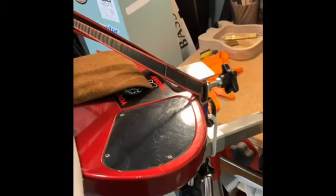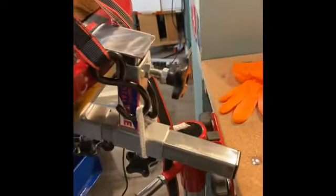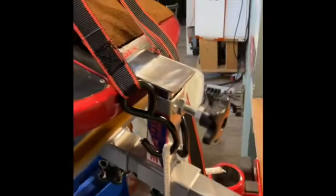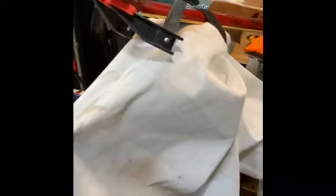I tighten the ratchet until it starts to get tight, then I twist the vise clamp until it gets exactly as tight as I want. The ratchets have too much space between notches, so the rope twist allows a much more subtle micro-adjust to final tension. I used rope in the back to secure the hooks and loop the strap up and through, which is slightly different than my last video.